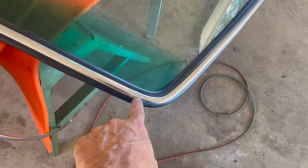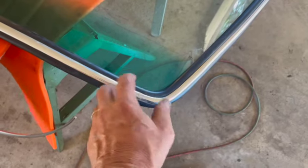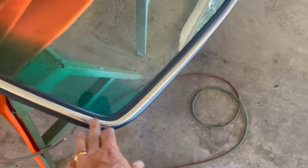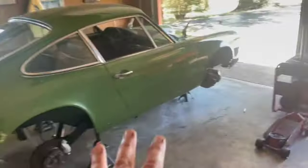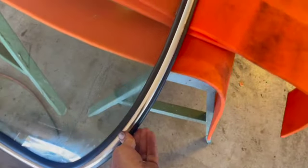Even with a piece of trim that a lot of people would say, I'd buy a new piece of trim. We did a little repair here. And even with a piece of trim that wasn't exactly straight, we worked it back into shape. You can just come over and bring your trim piece, put it in the track, and just shape it and shape it and shape it, and save you a lot of time because you'll work your thumbs to death trying to get it down there in that little J hook.